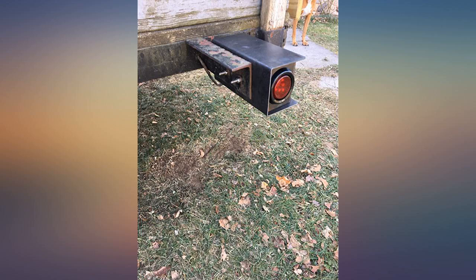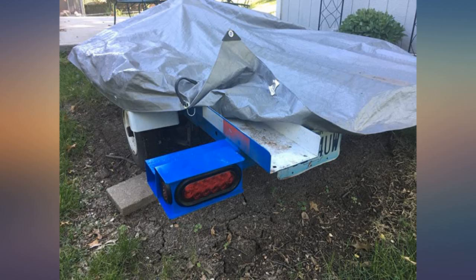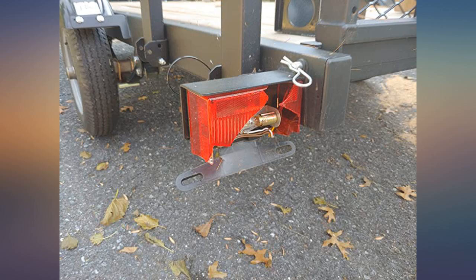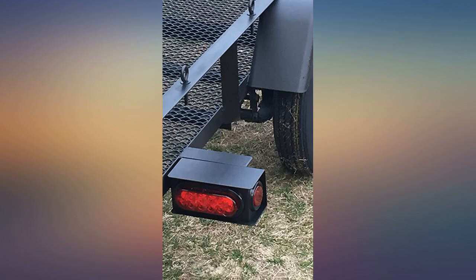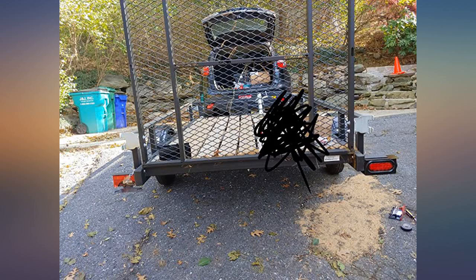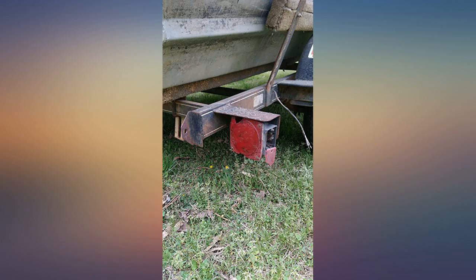For those who have asked, these are truck lights with a 3-wire pigtail for the 6-inch oval, and a 2-wire pigtail for the side marker. The red wire is stop turn signal, black is running clearance lights, and white is ground. So on a flat 4-wire harness, green and yellow go to red on respective sides, brown goes to the black, and white goes to the frame.